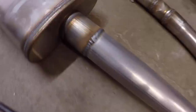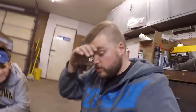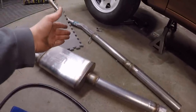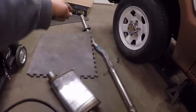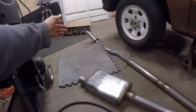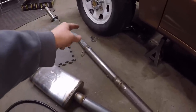We just managed to get these all welded up - they're still hot as you can see, still smoking. These welds are pretty good for not welding in a long time. I'm pretty happy with it - looks good. Luke and I came to the conclusion of what we're going to do: we had to flatten out that little section just a bit to make clearance so that flange would fit, and then that little piece connects to the header. We got that bolted up, and it'll go on smoothly with the gasket. Our thought was to make the muffler attachable - so we can switch between straight pipe and muffler - by using a U-clamp so it can slide on and off.